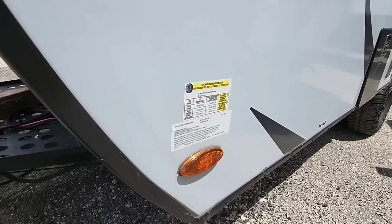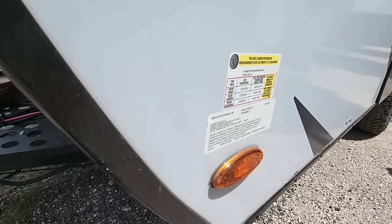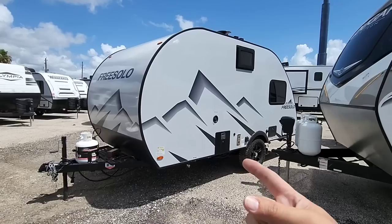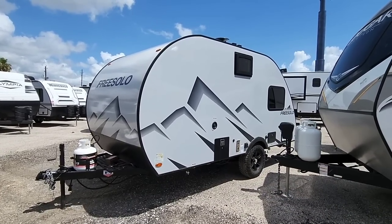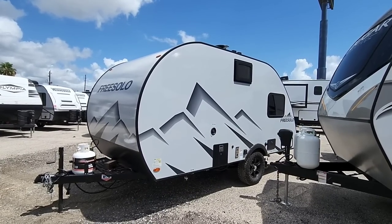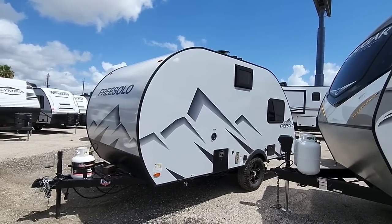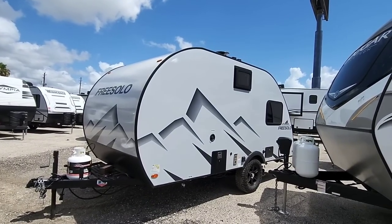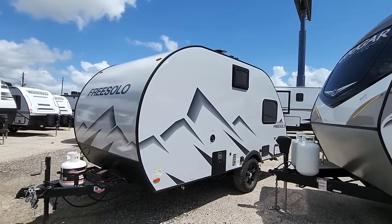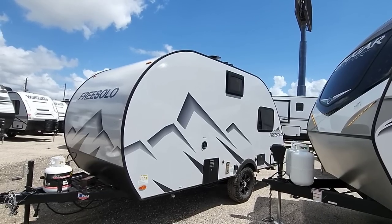Before we get going, let's take a look at the numbers on this unit. It has a gross vehicle weight rating of 3,320 pounds, super lightweight, and 925 pounds of cargo capacity. It's got a single axle rated at 3,000 pounds, so you can tow this with a lot of vehicles. You want to make sure you have both the payload capacity from a tongue weight perspective and the towing capacity to handle it — it's still relatively long and tall. A wagon or compact SUV is not going to work; you need something like a Ford Explorer, Dodge Durango, full-size SUV, or half-ton. And keep in mind there's a big difference between a Durango with a towing package and one without — most don't come with it.